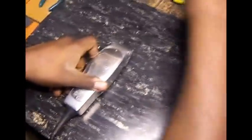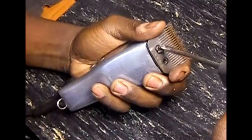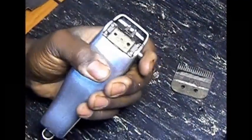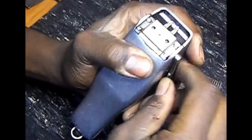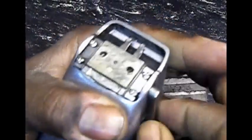The first thing you want to do is take the blade off. There's a lot of hair and stuff in there, so you pop the blade off. The problem is that this little knob is stuck under the pad — it'll be stuck deep in there. What you're going to do is take a small Phillips head screwdriver. You see this little knob there? That's stuck under your pad when it's not moving.